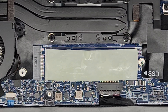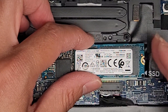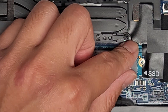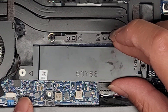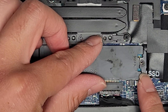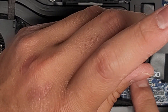We're going to put back the SSD from their old one. Hopefully it'll just boot up just fine. This is a M.2 PCIe NVMe SSD. There we go — slide this in at an angle, of course, then slowly drop it into place, get it all lined up, and get this screw back in. That's pretty much it as far as that goes.